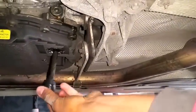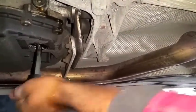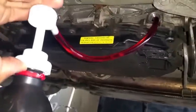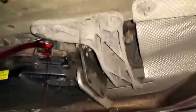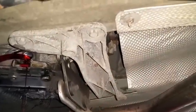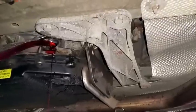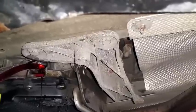After all the dirty fluid is out, you simply close your drain bolt. After your drain bolt is closed, open your fill plug and then just start pumping in some transmission fluid. I've been filling it for quite a little while — on the third liter the transmission finally started to drip some fluid. At this point I'll be turning the car on so all the fluid circulates inside and then I'll be able to put in more fluid.